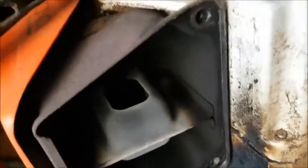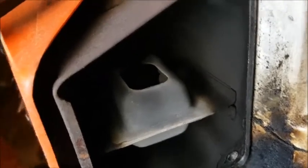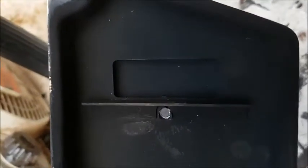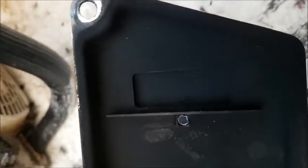So here's the muffler off, there's the front cover. You'll see the baffle in here has actually got big openings on either side, so there's no need to drill that out — the flow there is fine. If you have a look at the cover, you can see the opening there is about an inch and a half long by a little over half an inch wide. When you've got the screen in there, it's restricting about half the airflow, so the airflow is about half that size.